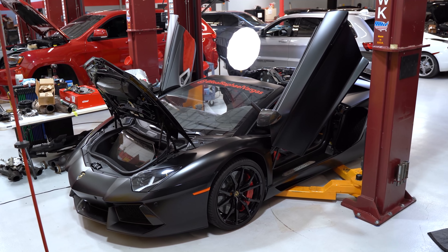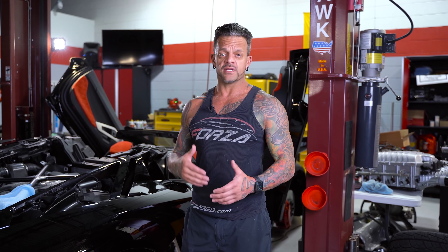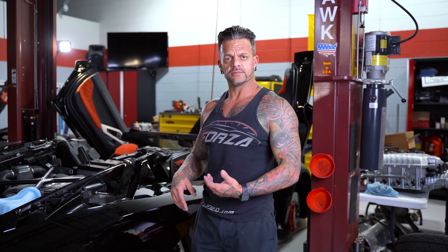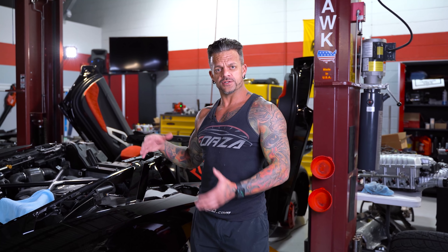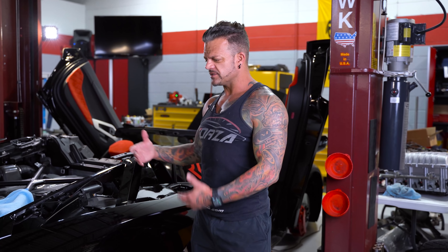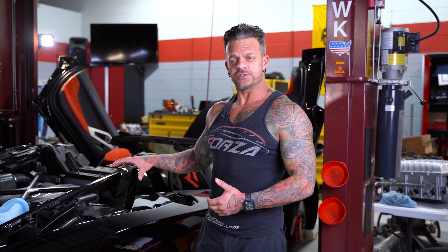You might notice the rest of the car is matte — that's not vinyl. The car is gloss black and we use satin paint protection film, which is pretty common on exotic cars. Paint protection film is a clear film that, if done correctly, you can barely see it on the car. You can get it in a satin finish and it gives the paint a matte appearance. A lot of people like that, and if you get tired of it you can peel it off and your paint is protected the entire time. Some body shops don't want to take the cars apart, so we'll disassemble the car, deliver the panel to them, and reassemble after painting.